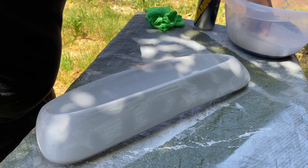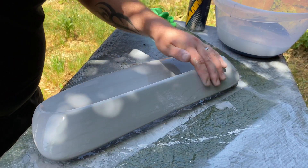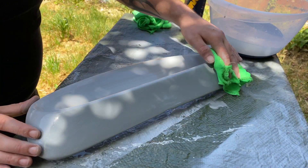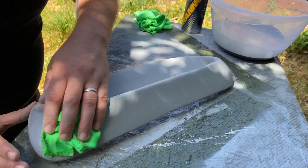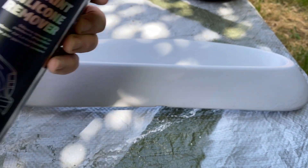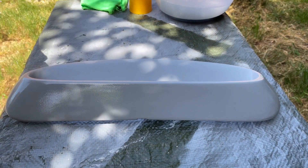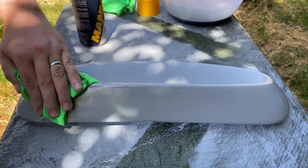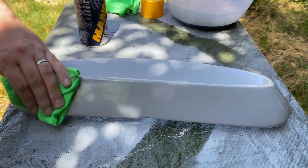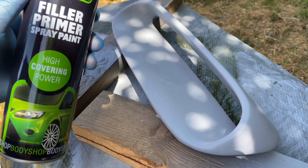It's all sanded down now using wet sandpaper with 800 grit to give it a nicer finish. We're going to wet the surface to make it easier to get all the dust off, then wipe the excess off with a microfibre cloth. Now we're going to spray it with some wax and grease remover to get all the excess grease and wax off from where we've been touching it - spray a bit on the surface and give it a good wipe. This makes the paint and primer stick a lot better. Then we're going to hit it with a couple of layers of filler primer and give that 24 hours to dry.